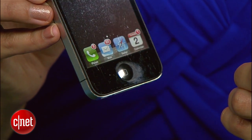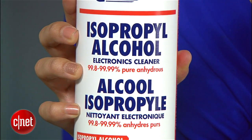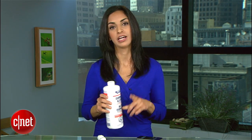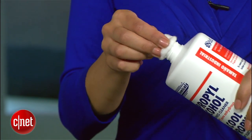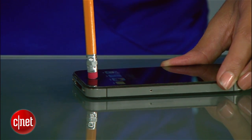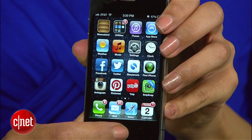But if your home button is still not responding well enough, give this next tip a try. Considering this is a physical button, you have to remember that there's space around it where dirt can get stuck. For this fix, you'll need 99.99% isopropyl alcohol, which you can find at a hardware store. Do not use rubbing alcohol because that has water in it and will further damage your phone. Using a cotton ball, tissue, or eyedropper, apply a few drops of the alcohol directly on and around the home button, avoiding the screen. Then grab a pencil or other narrow object and tap the home button to allow the alcohol to get in and around the button. Give it about 10 minutes to completely dry before checking to see if the alcohol solved the problem.